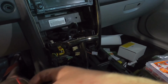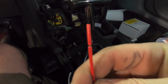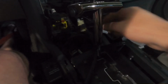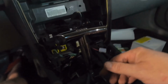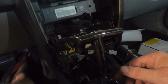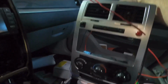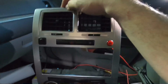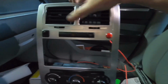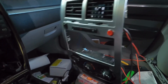So this is going to go to our green wire, so we can connect those up. And I'm sorry, our red wire. Oh boy, I better get this right. Nah, wiring for dummies. So we are going to connect the red wire to the trigger switch, and the other end of the trigger switch to our switched 12 volt, which is coming out of our panel right over here, which, as you can see, is completed. We've got our purge button, our master arm on and off.